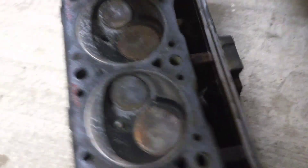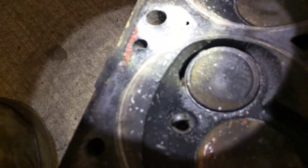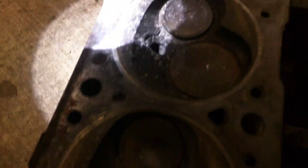I'll show you guys right here. Y'all can see that hole right there beside the exhaust valve. I don't know what causes that — running lean maybe. The aluminum's deteriorating around the exhaust valve here. The hole went all the way through, so it killed my compression.